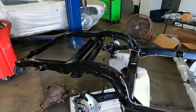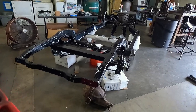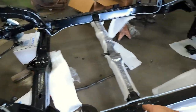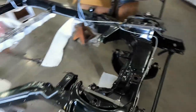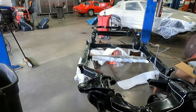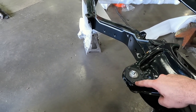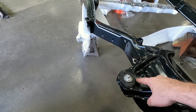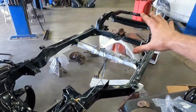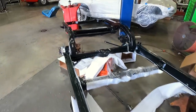You can see the chassis has had a little bit of progress. First and foremost, we get it up on the jack stands — we keep foam underneath just so I don't scratch anything. The fuel lines are in with the correct clips, rear trailing arms are in, fuel lines keep going forward, upper control arms are in. We always use top-of-the-line parts — there are a lot of variations when you go to buy these. We always get the best ball joints. I even go so far as to put the rivet-style bolts in so it simulates the factory rivets for the upper and lower ball joints. This represents probably two days of putting in bushings and assembly work.